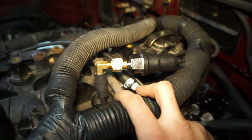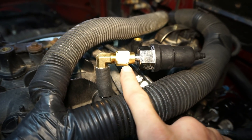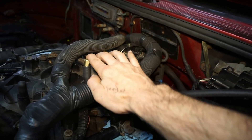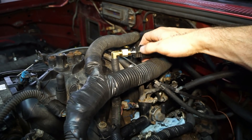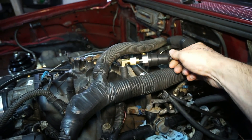I think I'm going to cut the PCM power. Here's what I've got going on today: this is the existing vacuum port that was going to the pressure regulator. I'm using a small piece of 3/8 hose and a 90-degree fitting, then a quarter-inch NPT down to an eighth-inch NPT adapter, with the pressure sensor sitting right here. This switch has a little boot on it to protect the wiring.